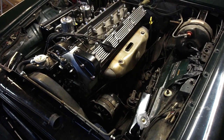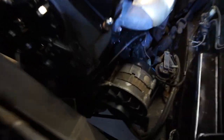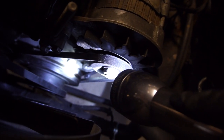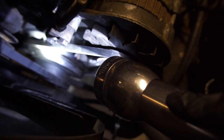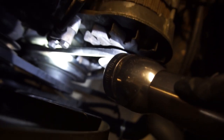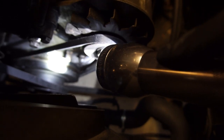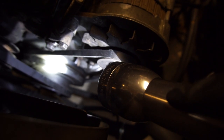In case it was difficult to see the timing marks and the timing pointer when I had the strobe going — I'm not really sure how well it shows up on camera — I've grabbed a flashlight to show what it looks like. That thing I'm shining on right there is the timing pointer. And then you can see some white text coming up here — those are the timing marks. All the way at the top is zero, and then it goes down in degrees. That's what you're aiming at with the timing light. It's right next to the alternator on this car. You're looking at the flat top bit of that pointer to be on the right mark — at 8 degrees before top dead center on this engine.